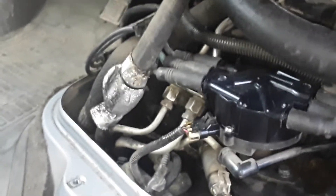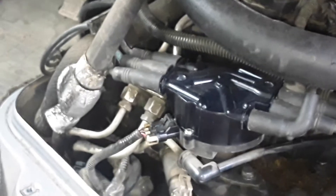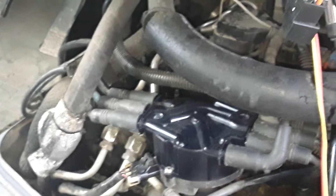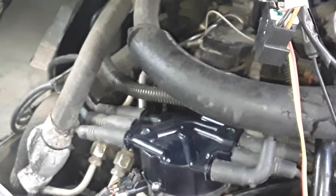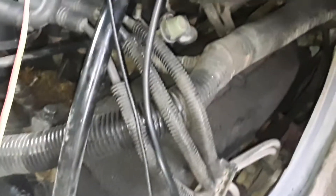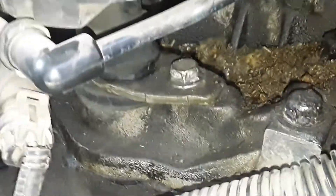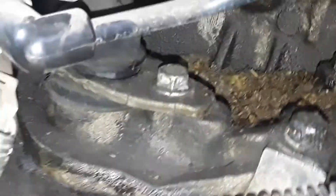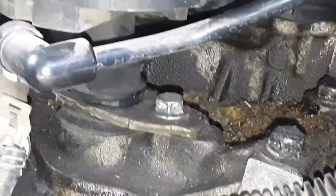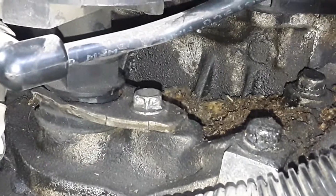I've run a compression test, I've run a cranking test. This has got a brand new Vortec — the new long spiders with the injectors on it, a new style Vortec. Gas mileage went up monstrously. While we're here, I'm going to talk about this for a second because I think everybody would be interested in it. This is a distributor hold-down for these GM distributors, and the cam retard is built into it.